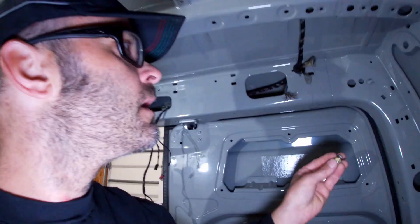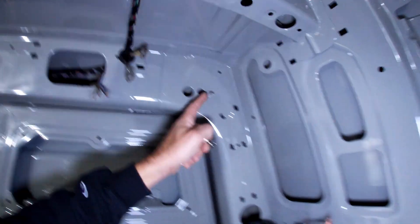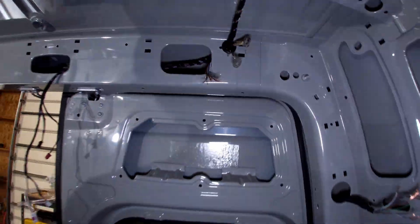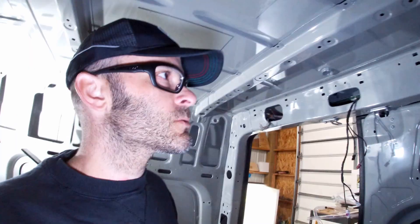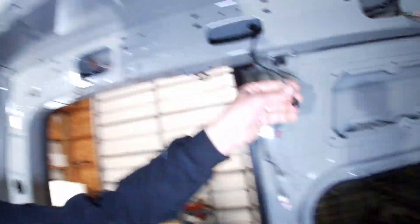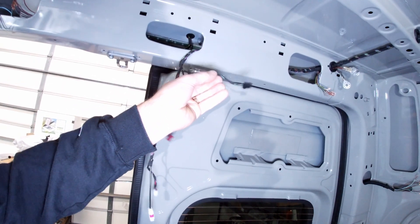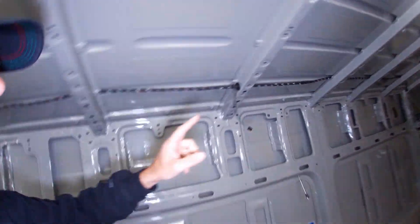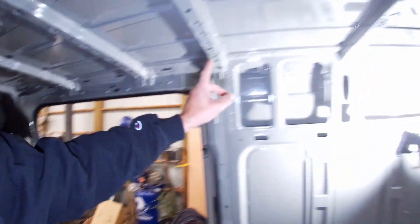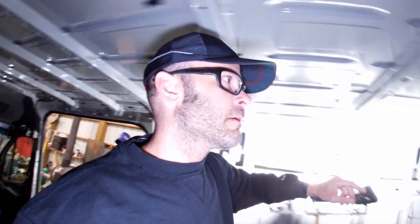Once you pull it all the way down, we're going to put a new grounding lug in up high like so, and this ground lug is going to get removed. These wires right here are going to get reconnected, and this one wire here is going to get cut off and lengthened — this is the switch wire for the factory overhead lighting. I'm going to extend it so it comes all the way down just in front of or behind the door opening for the rear light.